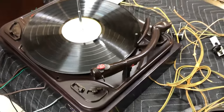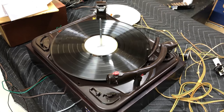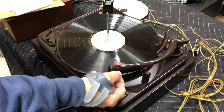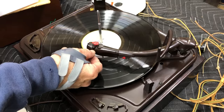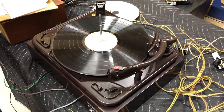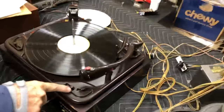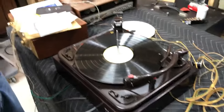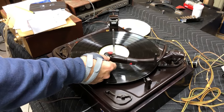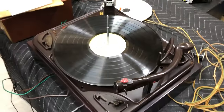Let's say you want to treat this like a turntable instead of a record changer — put it on reject. Watch what happens. Now all the mechanisms are done moving, and you can place this wherever you want. Now when it gets to the end of the record, it's still on manual, so it'll just be like a turntable — it's just going to keep spinning. Switch it back to auto and now it's going to come over here. It sensed no record, so it'll turn off.